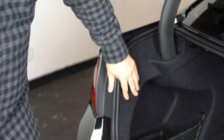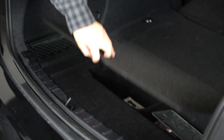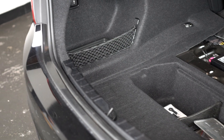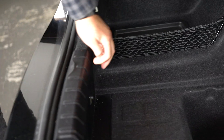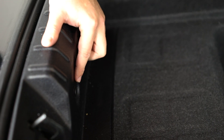Let's dive into getting access to the amp, which is behind this carpeted panel. The first thing we're going to do is take out this carpeted panel — it just lifts up and out. Set that off to the side, and then dive into removing this rearward plastic panel, which holds down this side of the carpet. This is held in by four plastic locking rivets. The way to remove these is with our metal panel removal tool or an equivalent tool you have at home — you'll come in behind this upper head piece and slot the tool in here.